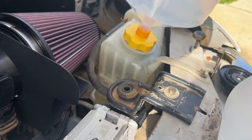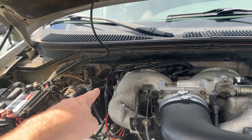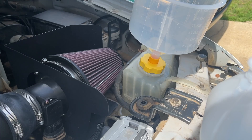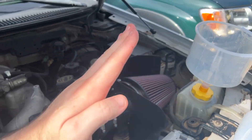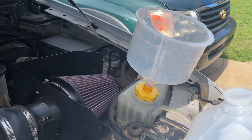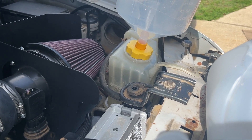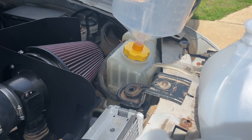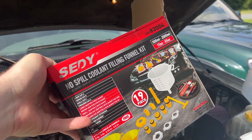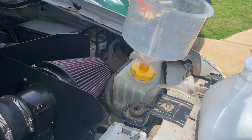It's still pretty high over here on the water level. Look, it's already bubbling up. Good thing we have our funnel here. This is now the highest point in the system, because otherwise the heater core is really high up — it's above the radiator and above this water bottle. So that's why I bought this thing, because this is very hard to bleed this truck without one of these, or you have to park it up on ramps. So the way that it's bubbling like this super frequently, this never happened before while it was idling. I had to rev it up, put it on ramps. So I can already tell it's going to be way easier to bleed the system. This little $15, $20 coolant kit is going to pay for itself in stride.